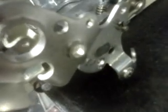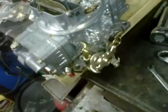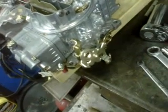Mainly the idle mixture screws, the carb idle screw, the pump cam, which if you see the 1 and the 2 there, I got mine on the 1 setting. You have 2 settings for that, and that controls your squirt nozzle, which is right down there. So those few items are what are most important to be tuned correctly for best off-idle performance.